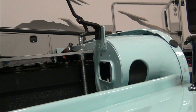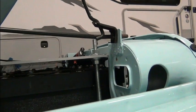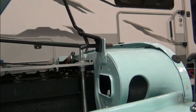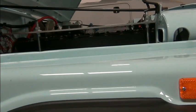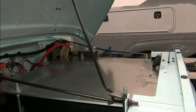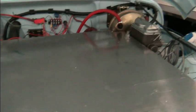So next up, gotta put something between these cells. Don't want to take any chance on this, you know, accidentally connecting. Matter of fact, I'm going to measure. I'm kind of curious what kind of clearance we have. When we put this plate back, it was clear in the hood before, so we know that we can have clearance if we go back to this height again. So let me measure that. It looks like the clearance between the top of the bolt heads on those interconnects to the bottom of that aluminum plate is 3/4 of an inch. So that's what we have to deal with. Let me find something to put between that to not have a short, and we'll see if we can pull this plate out of here.